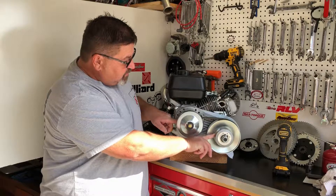I'm going to reinstall my sheave here with the flats. There's one side with no flats, and this side has flats on it — I'm going to install it with the flats out. It's very important that you put the outside of the driver clutch on dry, meaning no lubricant here. This is meant to be dry so this piece slides freely. If you had oil or grease on there, it will attract dust and dirt, and your clutch won't work very well.